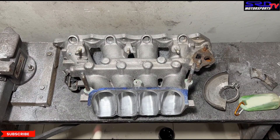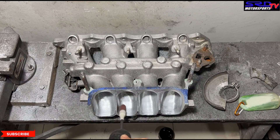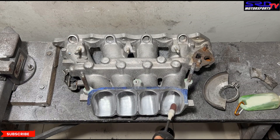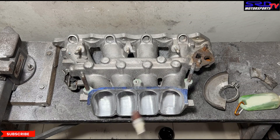It's quite fun getting to the smoothness and taper we're after. Taper is really important because the runners are quite short, so we have to incorporate a lot more taper. Plenum volume would also dictate cam and compression choices — we'll talk about that later.